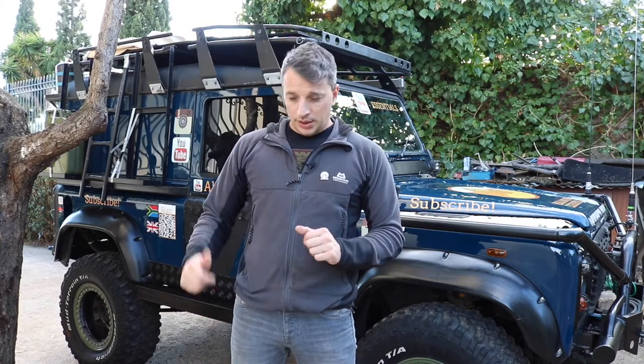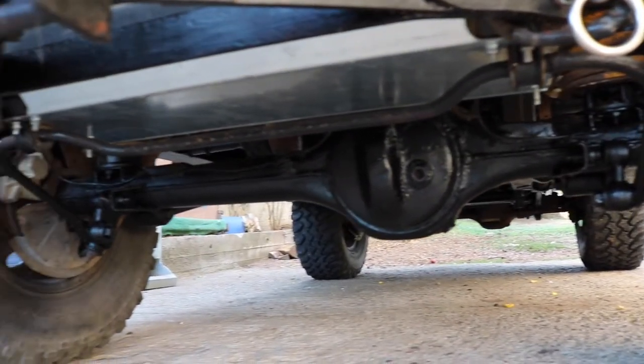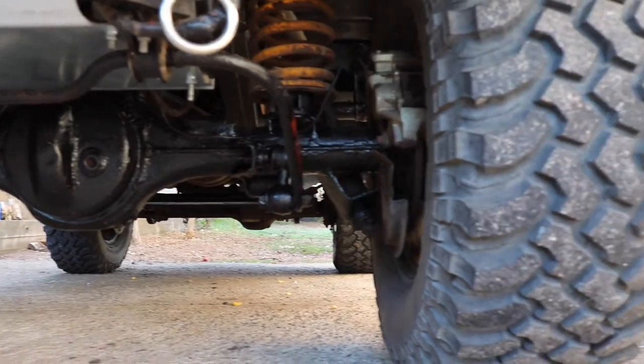The most significant thing I noticed was that the chassis itself was good, but the fuel tank guard was rotten as a pear — I mean right through. It looked okay at first, but when I pulled a bit of the side it broke off, and a screwdriver went straight through it — luckily not into the fuel tank. I couldn't get the bolts out of the anti-roll bar mount to drop the plate down, so I ended up lifting the floor in the back, bringing the fuel tank out that way, then cutting all the bolts holding the guard and anti-roll bar. I went ahead and put in a three mil galvanized sheet metal tank guard — same shape as the original, with the U-bend at the end — but with that thickness and the bend it's super solid. You'd be hard pressed to punch a hole through the fuel tank through that floor.